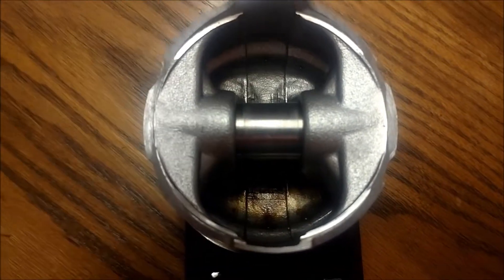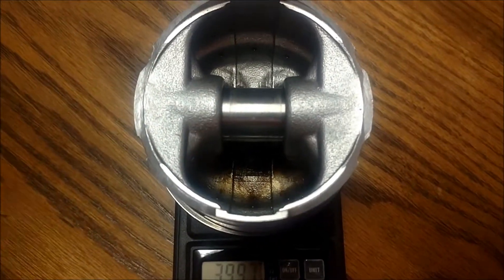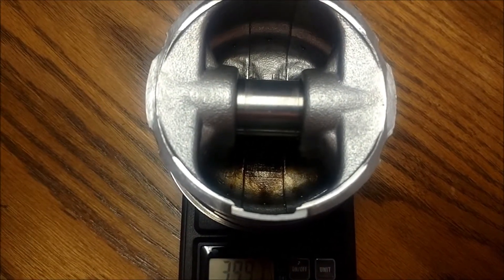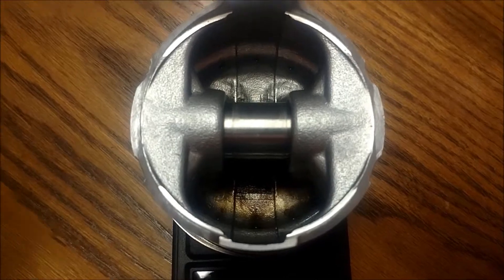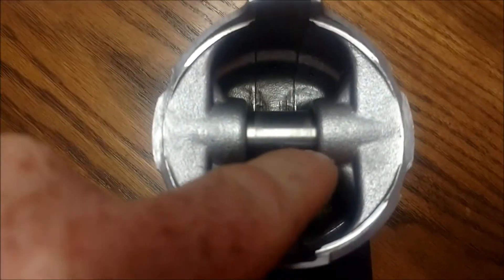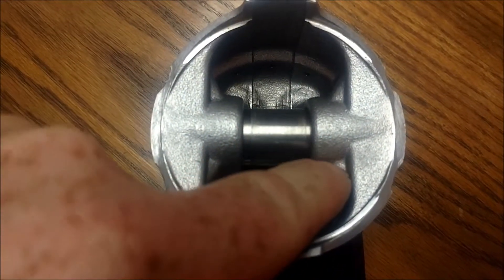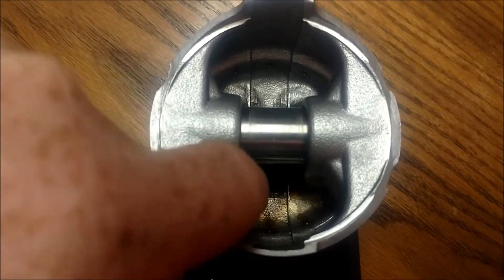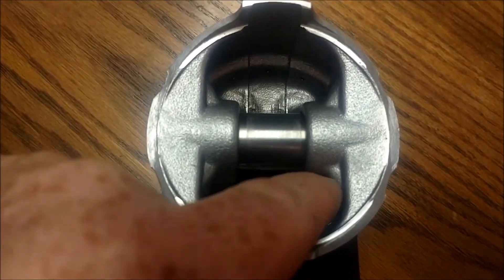Without rings is ideal, with or without wrist pin — that's up to you. After you find your lightest one, you're going to want to match all the rest of your pistons to your lightest one. You can take a little bit off on the sides, and you want to kind of keep it balanced.